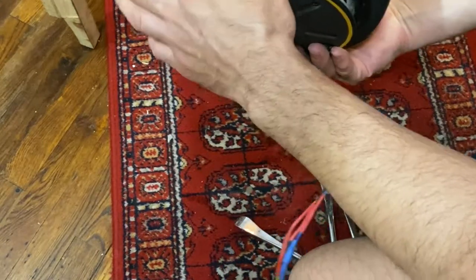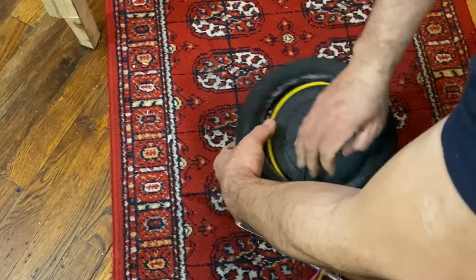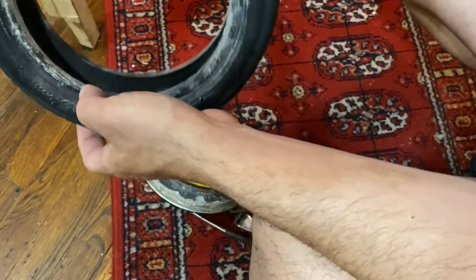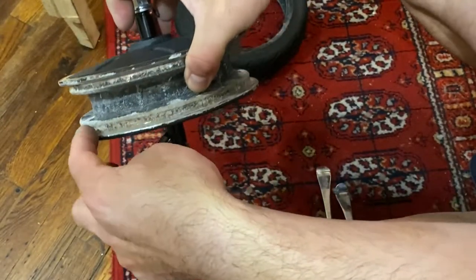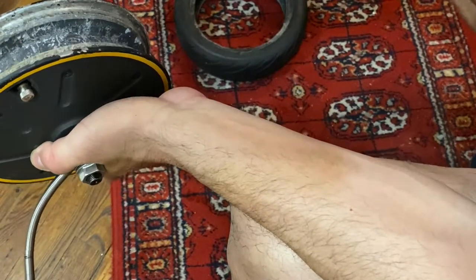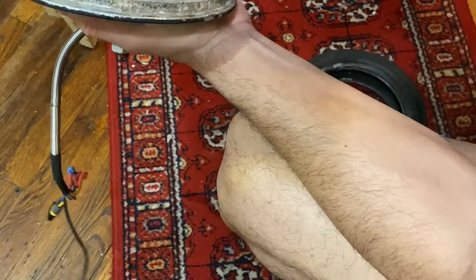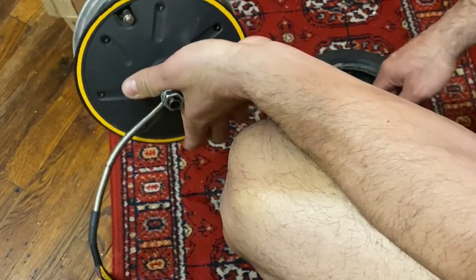As you can see, just make sure when you're removing it that the bead actually goes in the middle. The tire is damaged and the ring is basically destroyed. This has to be really ground and sanded because it doesn't come out that simple, so the bead can be smooth enough to put any tire on it. The tire itself is still good — I'm going to try to fix it — but as you can see, it was a lot of work to get it out. That's why I see people cutting tires off, making a mess, but there's really no need once you know how. So that's how we remove the tire.